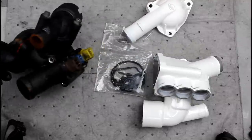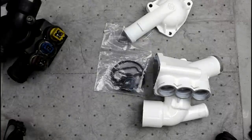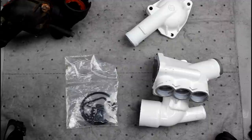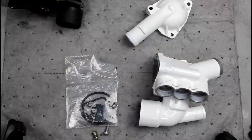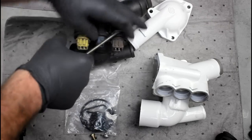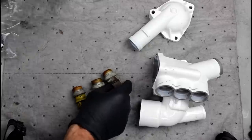We've got our old flange and our new flange — we need to swap our coolant temperature sensors. I bought a new thermostat so we can go ahead and install that as well, so we don't have to worry about doing anything to this new flange for hopefully a long time. One thing I really love about this Eurowise coolant flange is it comes with new bolts for both the thermostat end to the housing and for installing the entire flange to the cylinder head. Let's go ahead and take our coolant temperature sensors out, making sure they go back in the same location.